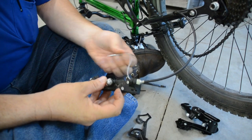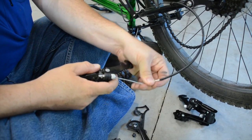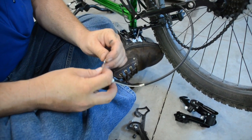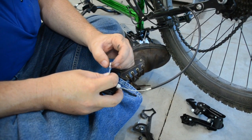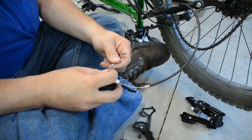You take this loose and that'll come out of there pretty easy. But then look at that — it doesn't fit up through there. It has this little piece on the end of it that's crimped on there. So I think you've got to cut that off, and then after you feed it down through the new one, you've got to crimp something on there to keep the cable from unwinding. That's what we're going to do.